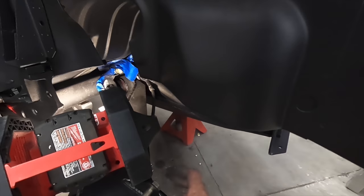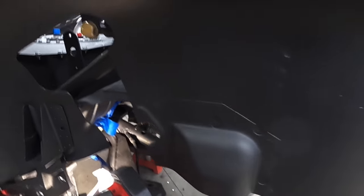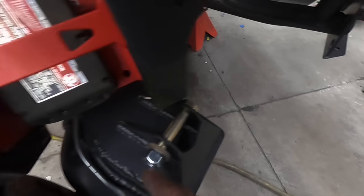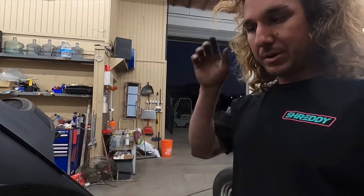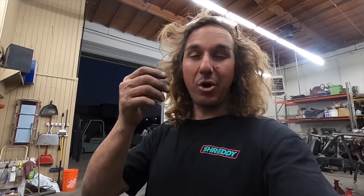I also got all my bolts today for my rear shocks. These are shanked — as you can see, there's a big washer on each side and the shank comes all the way through. This was a 3.5-inch long bolt that I cut down after I stuck it through, to make sure that the shank is all the way through. Those fine threads on the bolt, if it's sitting on the tab at a pivot point, that fine thread can wiggle around in there as things are moving and act almost like a file, opening up the holes over time. Just preventative maintenance.